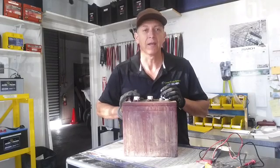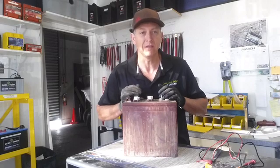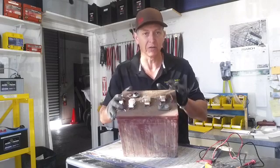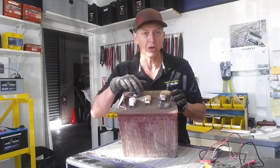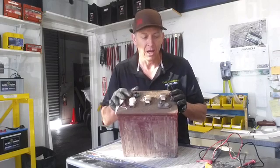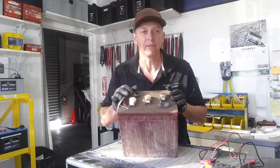Good morning. Jeff at Deep Cycle Battery San Diego. I'm coming at you with a how-to Wednesday video about keeping your batteries clean and dirt free. I'm going to explain to you how having a layer of dirt on top of your golf cart batteries — or your batteries for your RV or any application — will actually parasite the charge of your batteries.